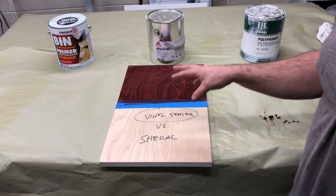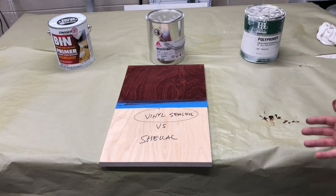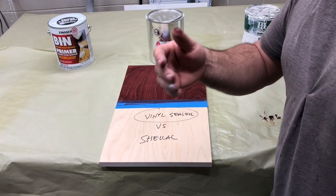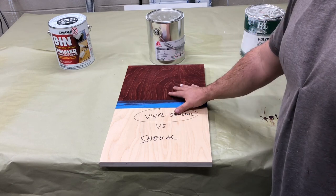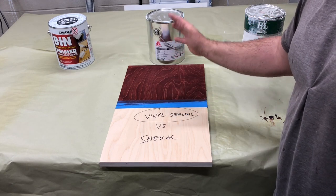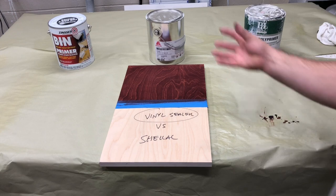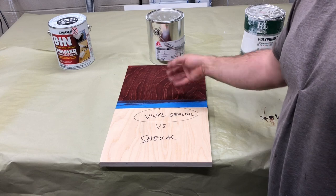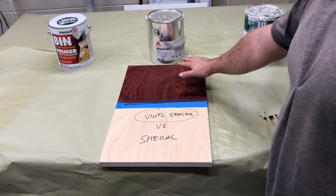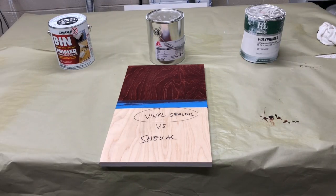The way I'm testing these is the way I would in a refinish job, because that's where a lot of times this stuff crops up. What I'll do is put a light mist coat on to kind of seal up the surface, let that sit for five, six, ten minutes, then come back over with a wet coat. That way you get a seal coat and you're not sanding that coat so you're bringing all this stuff back up to the surface. Do a sealer coat, then put another coat on top, then sand. I'm going to go spray these and then we'll come back and look at the results.